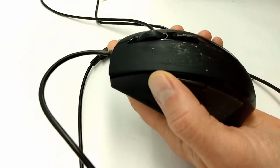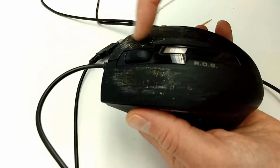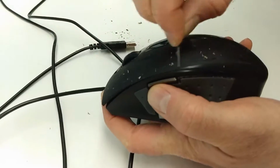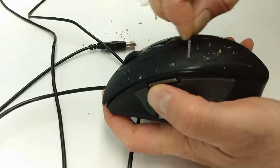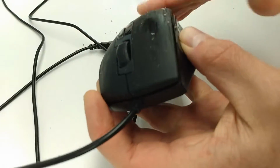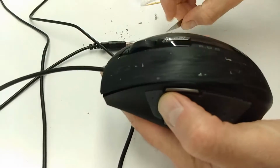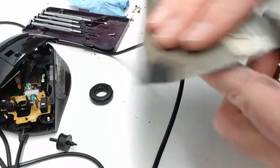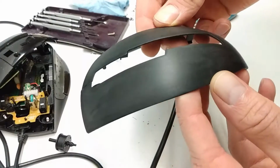Once I damaged the top layer, the only choice was to continue to soften it with the alcohol and scrape it all off. Oops. To avoid this kind of disaster, use a non-alcohol wipe or a soft cloth slightly dampened with plain water to clean your mouse. So after scraping all the goo off, I sanded the top of the mouse with some sandpaper to hide the damage. It's not perfect, but it'll do for now.